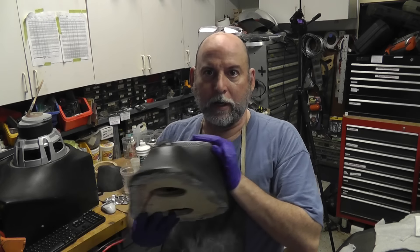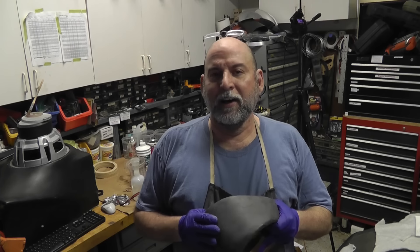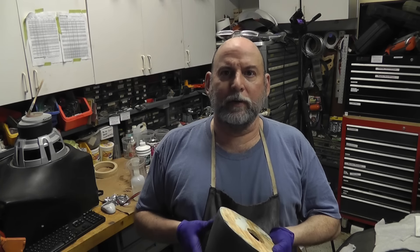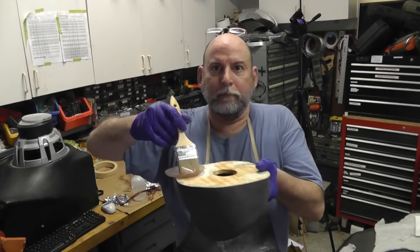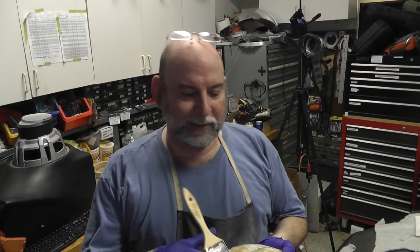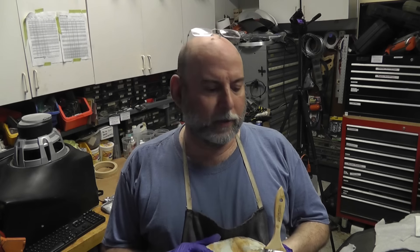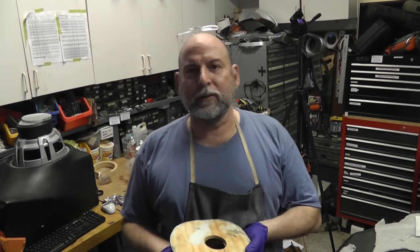And more importantly we've left it — if this was a car part inside the trunk — undamaged. There's our molded part; it's a basic fiberglass recess. Whatever you want to do, you can custom-shape it — it doesn't have to be a speaker pod. So this was just basic fiberglassing. Grab yourself a gallon of resin — I use fiberglasssite.com, but try and get it fresh, not from a store shelf where you don't know how old it is. Get some cheap paint brushes that clean up with acetone. Create modern works of art. Bill Hurd from Hackaday — hope to see you again when it's not near as hot!